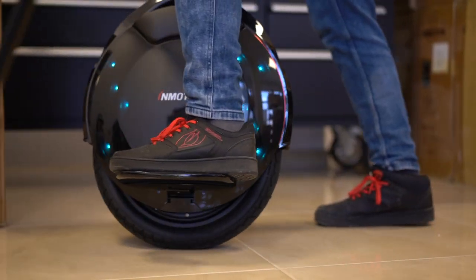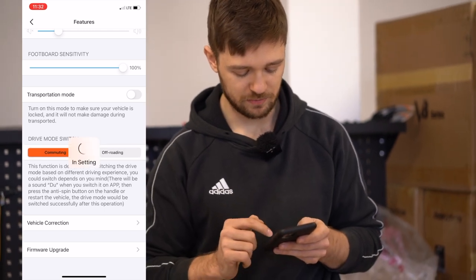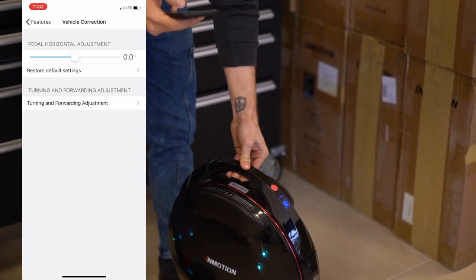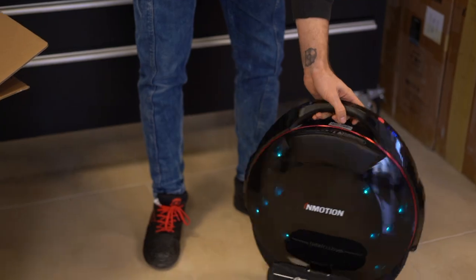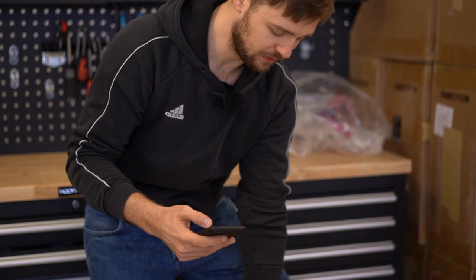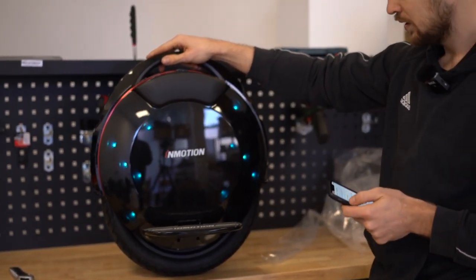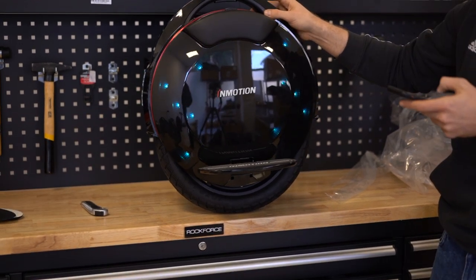Footpad sensitivity is essentially how quickly the wheel reacts to you riding on it — if you have it at zero it's really wobbly, but if you increase it, it's way less so. There is a drive mode switch for commuting and off-roading: off-roading is a softer mode where the wheel wobbles a bit, and commuting is way more responsive. You can also calibrate the wheel — in InMotion press the turning and forwarding adjustment, hold the lift switch in its most upright position, then confirm. When you turn the wheel the pedals shouldn't go up and down. It's best to set up calibration against a wall. You can also adjust the horizontal tilt, which tilts the wheel to a certain angle to suit your riding style.